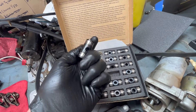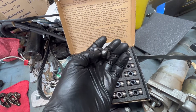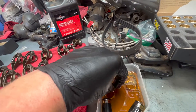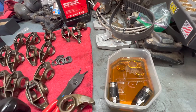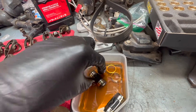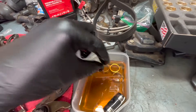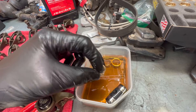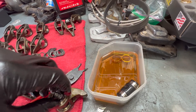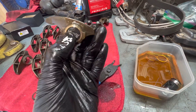I know there's a big deal about people putting these on wrong — they'll put the bolt head on the wrong side, so that's something we've got to pay attention to. Pretty much what the instructions say: grab a bushing, stick it in — it goes in easy. Flip the bushing over onto a flat surface, take the actual trunnion itself, stick it in. Then get your snap ring on, take your other bushing, bottom it out, and then install your snap rings. That's how you install your trunnions.